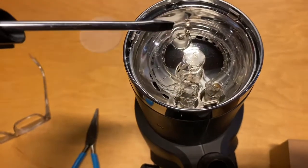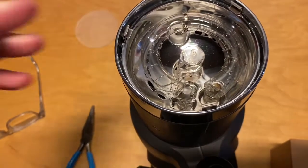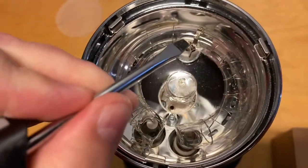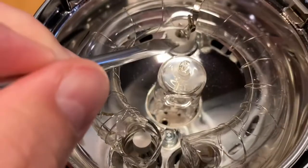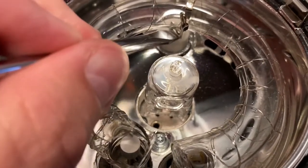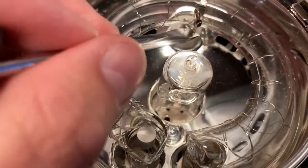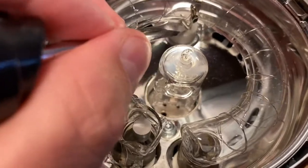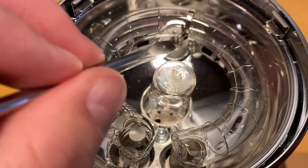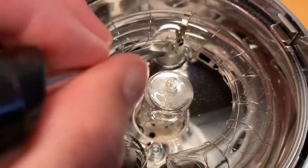If you've used other models of strobe, you know there's another connection here — that's the little trigger circuit, sometimes called an induction coil. What's different on this model is there's a wire that goes down inside here. This light hasn't been plugged in for a long while, so I know it's safe. If your strobe has been plugged in recently, please don't put a screwdriver in here — you might regret it. This wire stays in there, and if you try to pull the tube straight out right now, you're going to rip this apart and probably have to send it back to Profoto to repair, because that wire is soldered in.